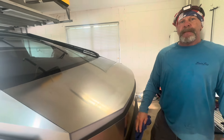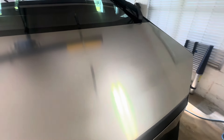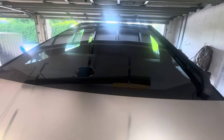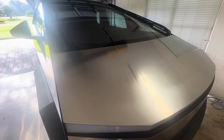We've got the hood lightly polished — very light. I'm really liking the results: very even, not seeing any staining. Wiped it with panel prep many times. So now we know the process we're going to use on the stainless. Before we do any more of that, we're going to go ahead and do the glass first, because we're going to ceramic coat the glass and we'd have to lean over the truck to reach it. So we'll do the glass first, then finish out the stainless.